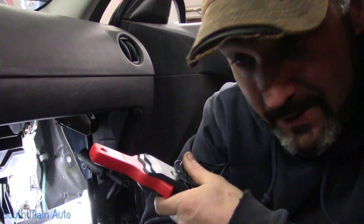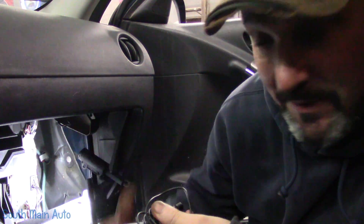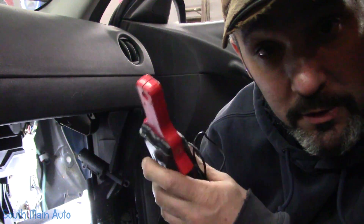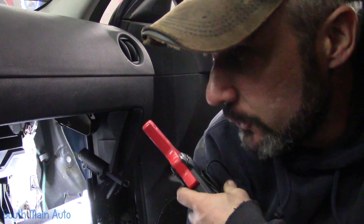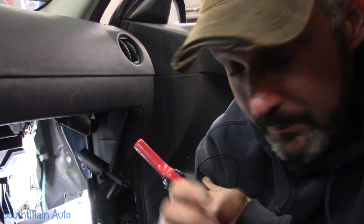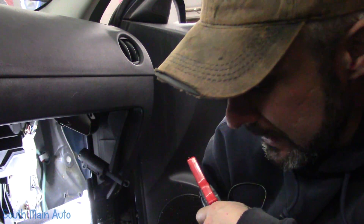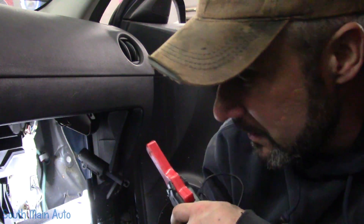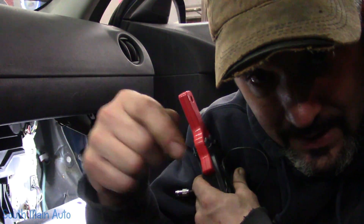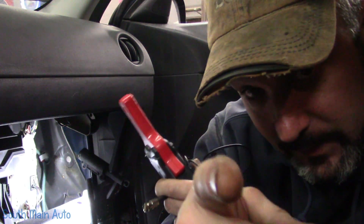I've done some other videos on this. I'm going to see if I can find those — the one I did with a test light, which is also a simple test. However, you have to have the motor out where you can physically spin it by hand. And I think I've done other motor failure videos using an amp clamp on fuel pumps, on cooling fans — any type of brush motor, you can easily see and get a pretty good overall state of health. Are the brushes making good contact? Is it pulling good current? Or are there big open spots like we saw here? Every time the current goes down to zero amps, that's a dead spot — and when that motor stops there, it's not going to start until you give it a whack. Go down and leave your methods, questions, comments, and criticisms in the comment box below. Don't forget to subscribe, find us on Patreon, and just remember viewers — if I can do it, you can do it. Thanks for watching.